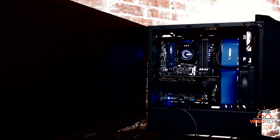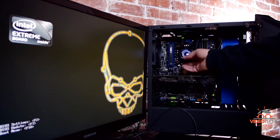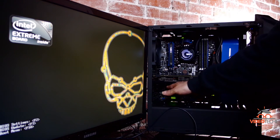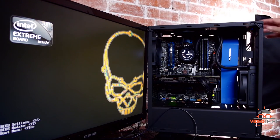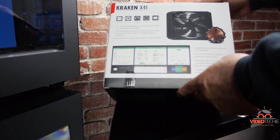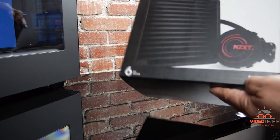Let's wire this up. So far, so good — the lights are solid. The cooler is working fine. The front fan's fine, the graphics card's working well, and the two exhaust fans are working the way I expected. However, this motherboard is not going to post. But this was supposed to be an unboxing and installation of an NZXT X41 Kraken CPU integrated water cooler — that part seems to have worked great. Stick with me in the next video, and we'll debug this motherboard issue.